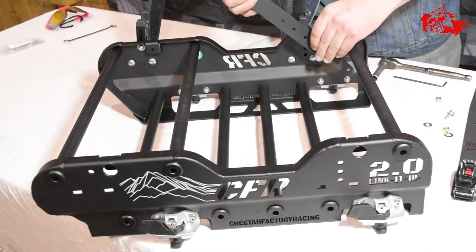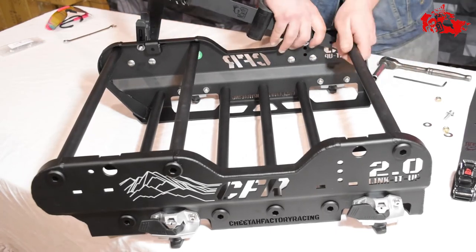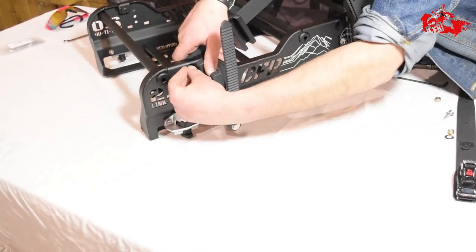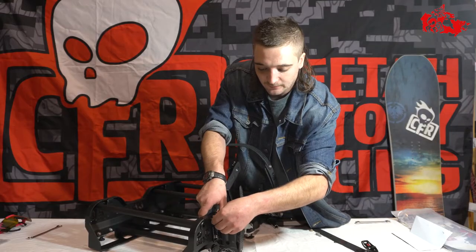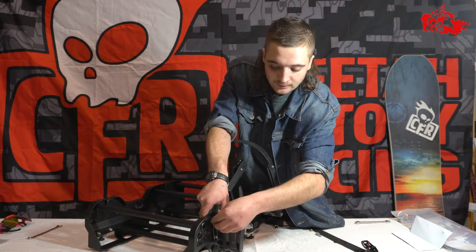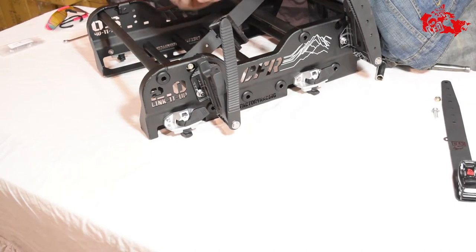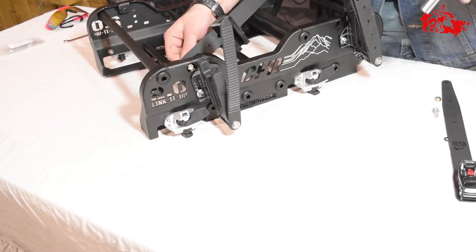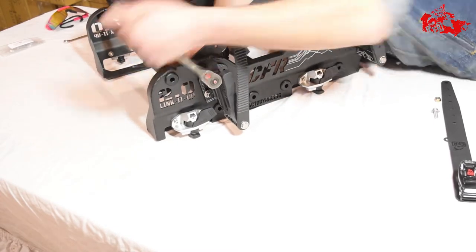For our board I usually go three holes on the front. Got my washer in there, slip this bolt in there — now you can see it's just poking out there, which gives you enough room to slip that washer on there and get that nut just started. This is the hardest part — this is as hard as it could be. All right, now that's in there. Get the Allen key on the back and that hole should be big enough to fit a socket. There we go, just snug that up.